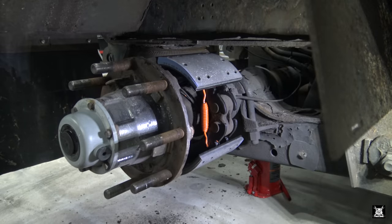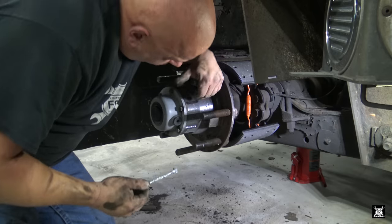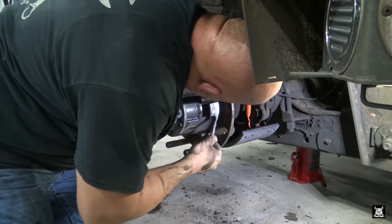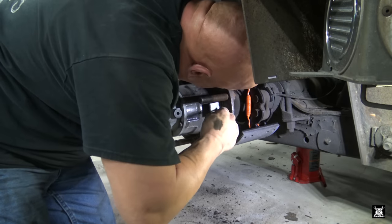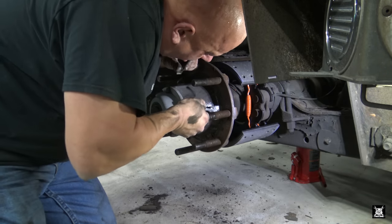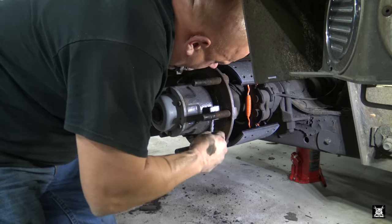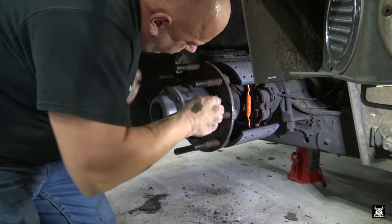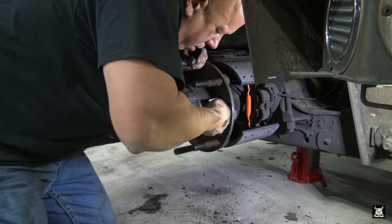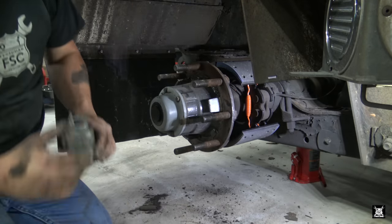Here we are. Now, to prepare to put the tire on, we're not gonna put any never seize on the threads, but we do wanna put never seize on here because that's where the rims get stuck on the hubs, especially the inner one. The outer one always comes off pretty easy. It's that inner one, it really fights you. I think my step deck had four of these tabs where this one's only got three. That did seem to solve the problem some.